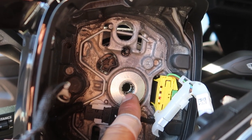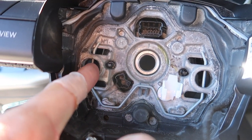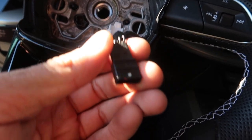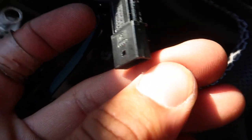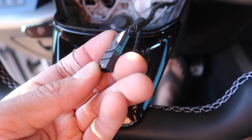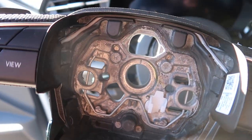Get your M12 triple square, take the steering wheel right off. Here you can see where you're going through and getting that Allen key to push these in to unlock — you slide your little connector out of here. See that little empty spot right there in the middle? You gotta push down on that and then this pops out. It looks like it comes apart at a different spot but it doesn't — it's just a really small male end that goes in there. I thought it pulled apart right where the size changes, but it pulls apart down here, so keep that in mind. Got my M12 out, boom.